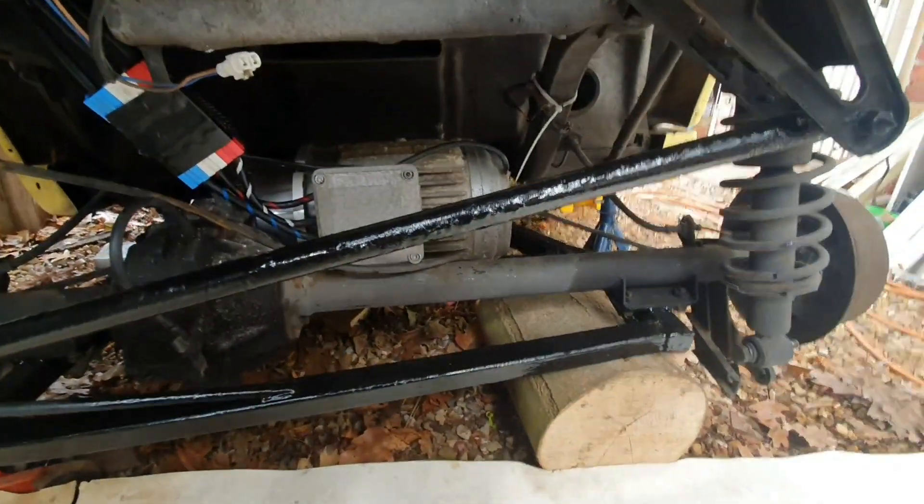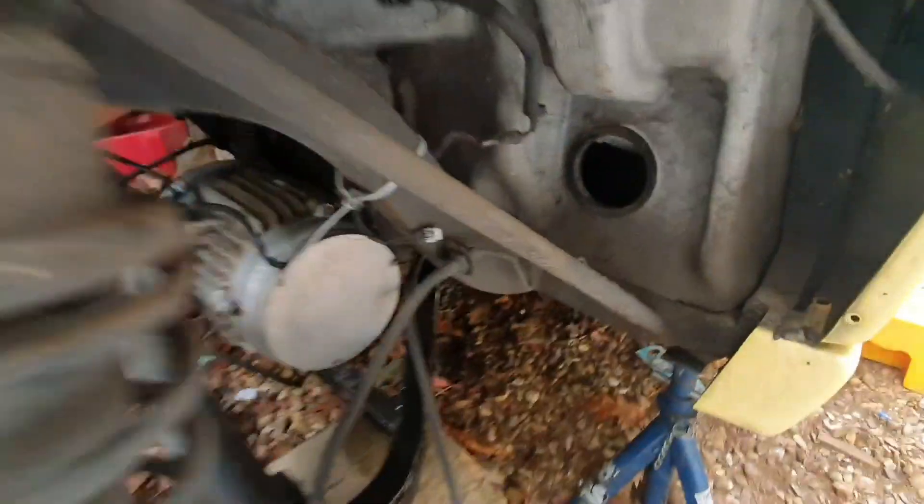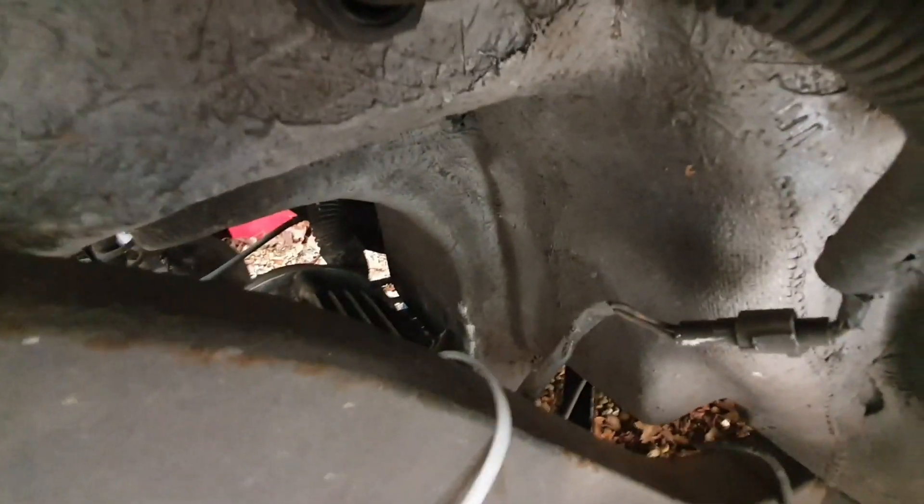I've got this back up on the axle to do a little bit of work behind here. You can see this vent that's just in the back there. The plan is to try and cut some of that away so that the back end gets some airflow coming in over the top of the motor, because it's so close to the motor — literally almost touching it — and that's likely causing a lack of airflow and possibly the reason why it's burning up.